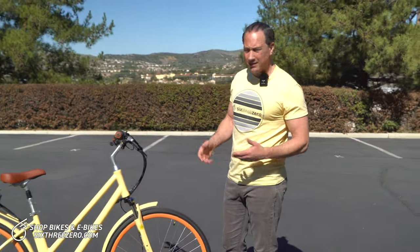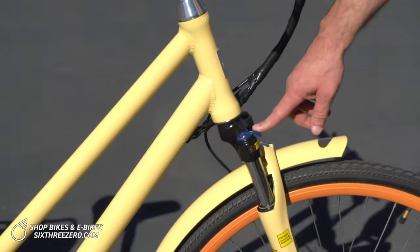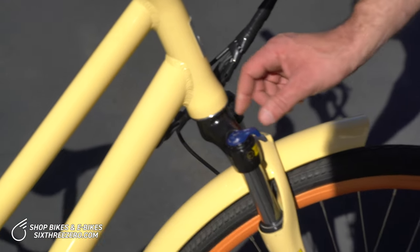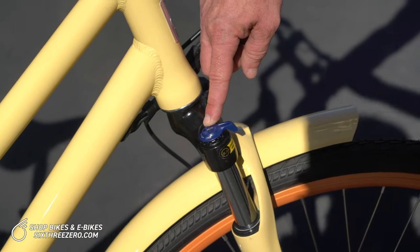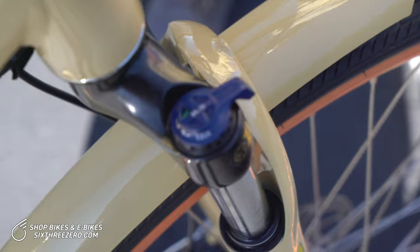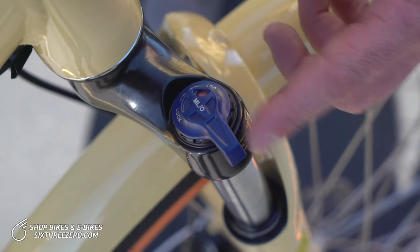Many people actually do it while they're riding, but please don't do that if you're not comfortable with it. So here it is — we just have a little lever right here, and it's either in the open, or basically unlocked, or closed, or locked position. Right now it's in the open position, and you can even see there's a window on this particular one that has a little green in it — can you show that, Nate? There's green right in that window, showing that we're in suspension mode. Then all I have to do to lock it out: it says 'lock' with an arrow, and I'm just going to turn it clockwise. The window turns red and now the forks are rigid.